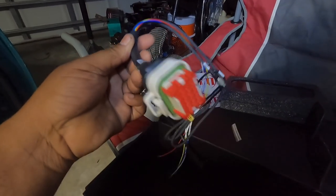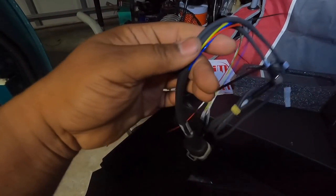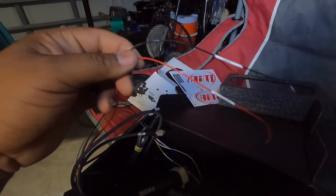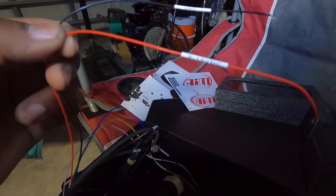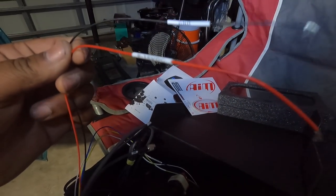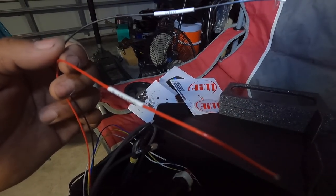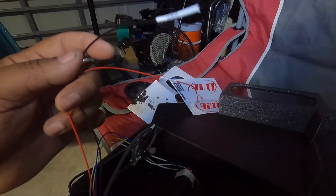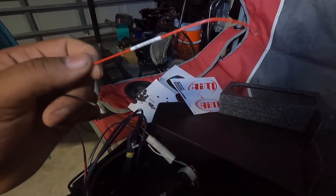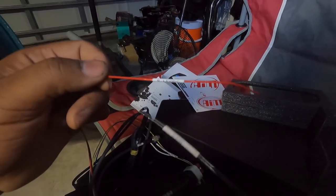All right, so you're gonna grab your 14-pin harness that comes with the dash, if you're buying it, or whatever, or just watching. These two are power and ground. You have your red wire power, black wire ground. You could use the power and the ground from the ECU, but I'm not using that. The ground is going straight to the chassis, and my power is going to my switch panel, which is on a relay system. So that's a guaranteed 12 volts.